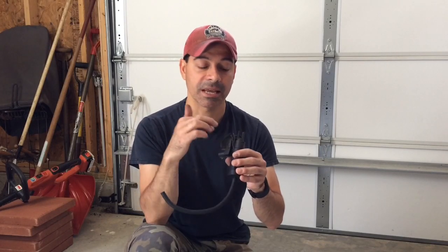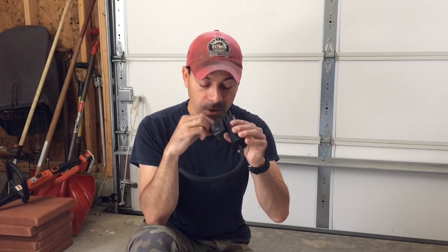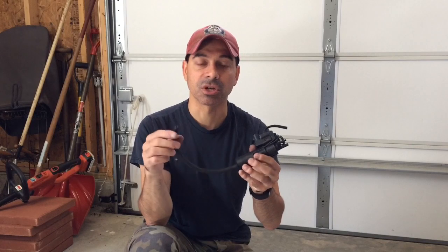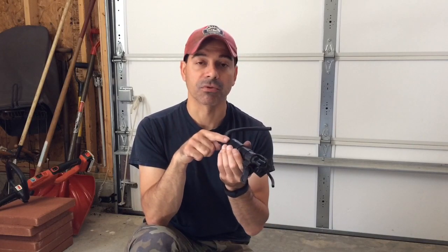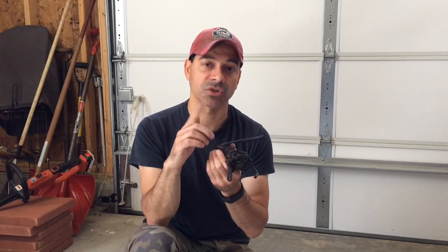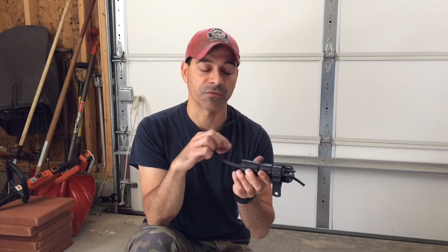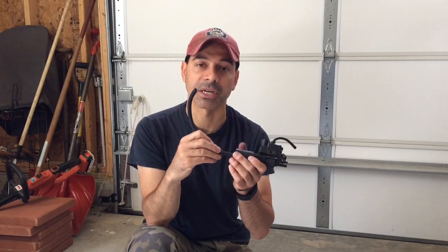And if you heard that, it's coming through here. The plunger is definitely in the open position, but let's see if it's coming out the other way as well. Everything else is closed, so it looks like the input coming through the filter is stuck open. We're going to connect it to a battery and see if we can get the actuator to respond and close the plunger as it should. If not, this is stuck in the open position, which is creating basically a large vacuum leak — and that will create some issues with idling and the engine because you're getting too much air coming in.